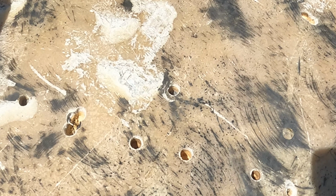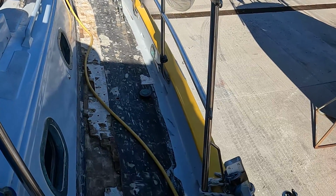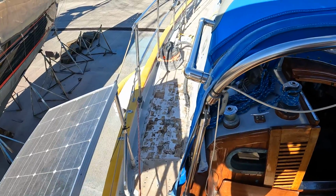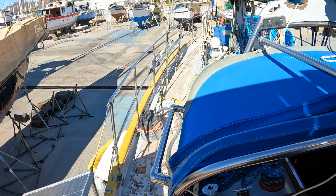After vacuuming, bright wood in the foredeck peeked up through the holes, indicating nice dry wood. We think most of our water intrusion was caused by the leaking ports, as we have detected core rot only along the cabin sides.